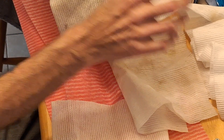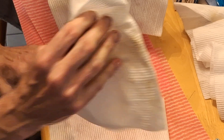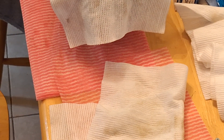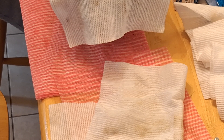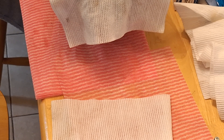That'll actually be all the oil I put on these cylinders. You don't want to put too much oil in there — the rings won't seat very well and it'll take a really long time for them to seat. I've seen too many guys get cylinders with instructions saying there's enough oil, don't add more, and for whatever reason they dump three, four, five, six ounces of oil down the cylinders — probably because their grandpa did it that way. Then it smokes like the Dickens and they're complaining it's smoking, thinking something was screwed up with the piston or ring fit. It's all because they dumped too much oil. If you can see oil coming out the exhaust pipes, you know they put too much in.